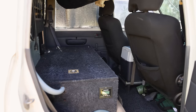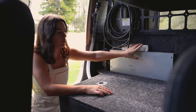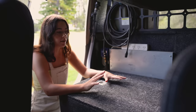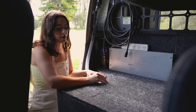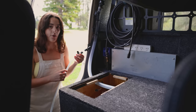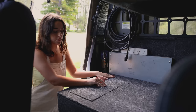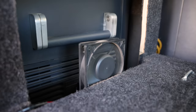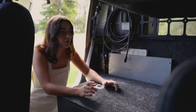Now for the middle of the car — this is where we normally keep a lot of our general supplies, clothes and living stuff. Starting with electronics, we have a 1000 watt Enerdrive inverter down there which connects to a 240V charging board. That's super handy because we normally have our camera gear and laptops here so we can easily plug those in. We also have 12 volt charging ports coming out here. Under this false floor we have an 85 litre water tank, and we also have 45 litres in the back, so all up we hold 130 litres. We also have a fan that we run up north if it's too hot for the fridge, just to keep the air flowing.